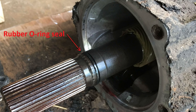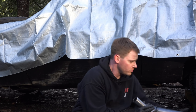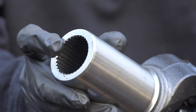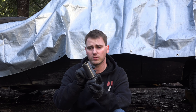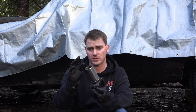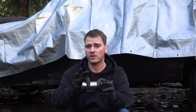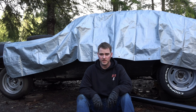On a Turbo 400, there's actually an O-ring on the output shaft that the yoke has to slide past. The Muncie doesn't have that, so we don't need this machined-out area. So what I had the shop do while they had the shaft was install a yoke that has the splines coming all the way out to the end. If you add the half inch of splines and the extra five-eighths, that's more than an inch of contact surface back on the splines — not to mention getting this further into the bushing that's supposed to center it. So with all that combined, it should work much better. And while I was at it, I replaced the pinion nut with a new one.